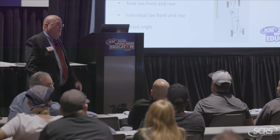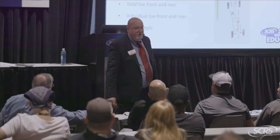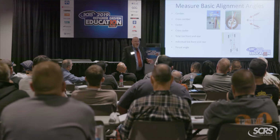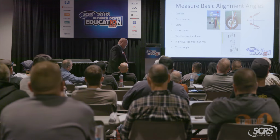When I came into your shop from the insurance side, if you handed me that printout that just has camber, caster, toe in the front, camber, toe in the rear, that is a maintenance alignment, okay? And that's what they quote for that blank 95 price. And a lot of times that's for a thrust angle too, which I'll go into here in a minute.